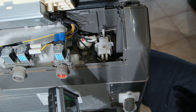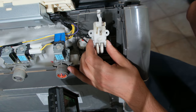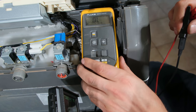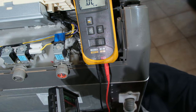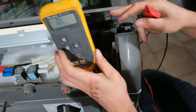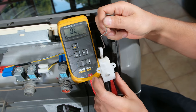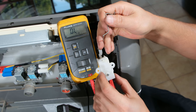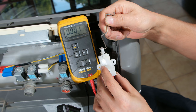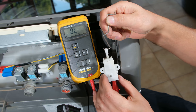There's the lid, so you can see how this limit switch works. I unhook it — there we go — there's the plastic limit switch. I've brought a multimeter set to continuity, which measures short circuits. When you put the leads together you hear beeping and see zero, meaning a dead short. I'm going to unplug the switch and put one lead on each terminal. At the moment it's an open circuit, which is the fault condition — the machine must cut out.